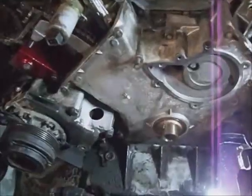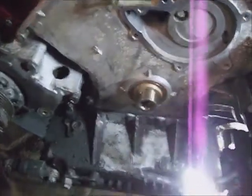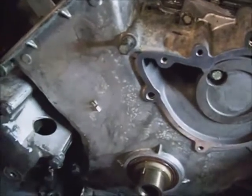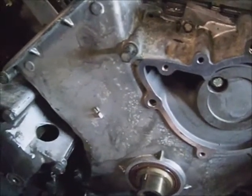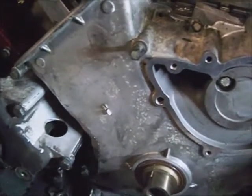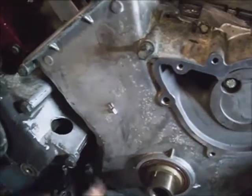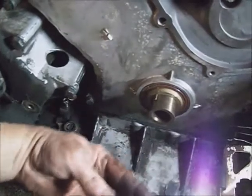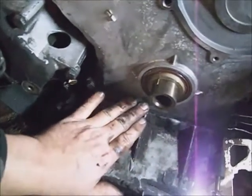Got my wire. This block shouldn't interfere with the cover — it hits above the seam. To make reusing that upper oil pan gasket feasible, I set the cover in there and got these two 13mm bolts started until they just started in those dowel pin tubes, then went underneath and held the gasket back. I took a 13mm and was tightening these bolts down while holding the gasket with my hand, letting the cover slide across the gasket.